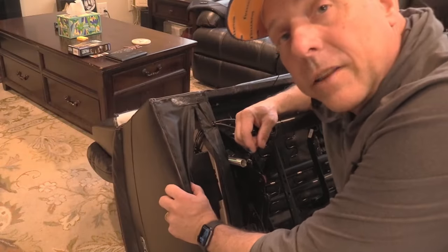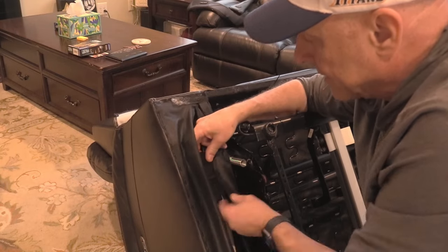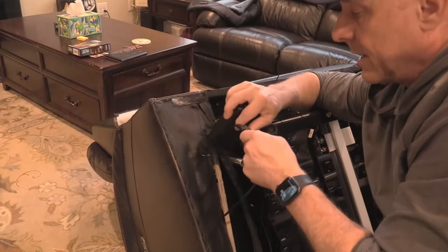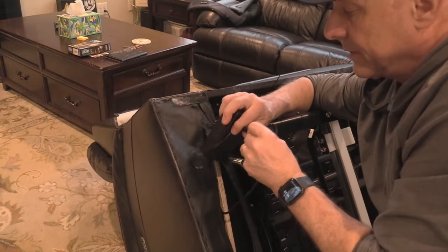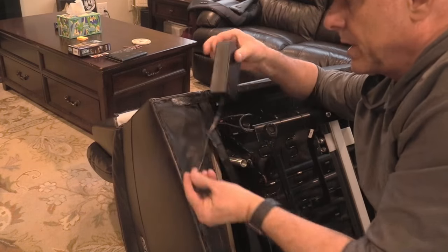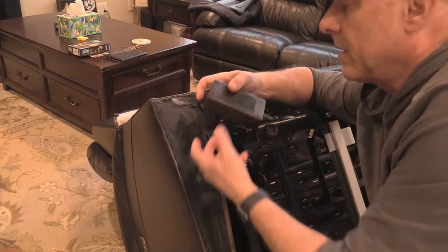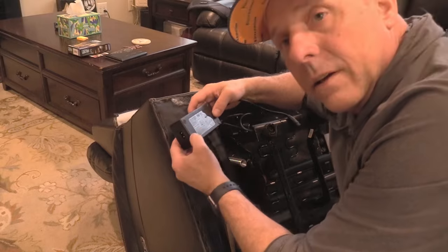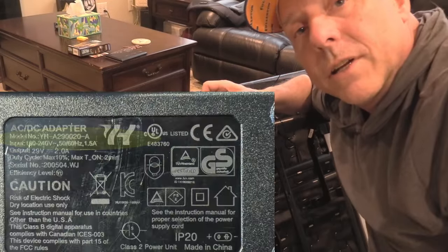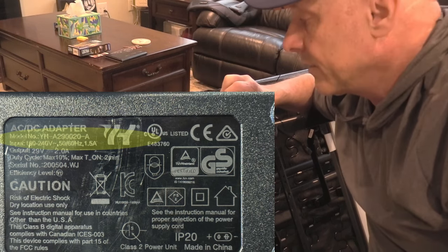Now, if that's not the problem, the other issue could be the power supply itself. That's this unit here. Again, very easy to replace. You just unplug it, and it's just one piece like this, and then you can buy this as a complete replacement on Amazon also. We have that in the description below also as a link. So check your model number on your unit, look for it on Amazon, or use my link if it's the same, and then just swap that in.